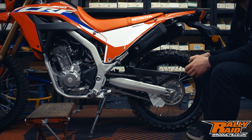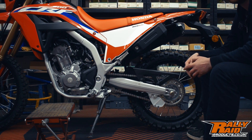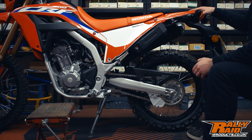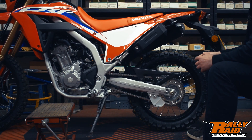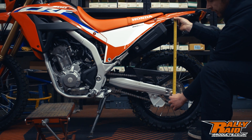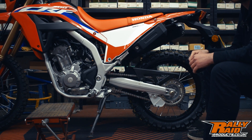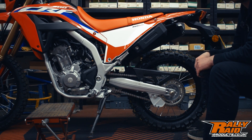Ash is at the front of the bike balancing it. We've removed the center stand so we can take the measurement of the bike compressing the suspension under its own weight alone. Going to our repeatable point and measuring down to the rear axle, this time our measurement is 560 millimeters. Next step is to get a rider on the bike and do the same measurement again.